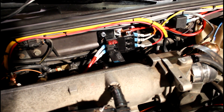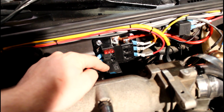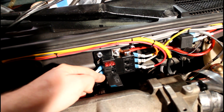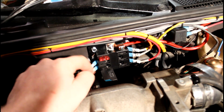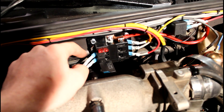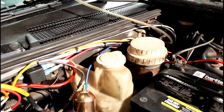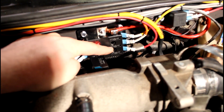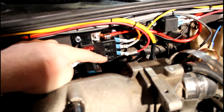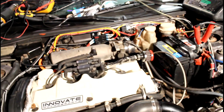I've got a breaker right now because I don't have a 2 amp fuse yet — it's a little push-in push-out breaker that slides into a fuse slot, pretty cool at about 15 bucks, but too rich for me to do the whole system in. Basically I've just got the Megasquirt powered up right now. Fuel pump power goes here to run the ASD relay and the fuel pump relay. The fuel injector power and spark power for the coil are disconnected — I just want to verify my crank sensor, make sure it's all wired in and set up right.